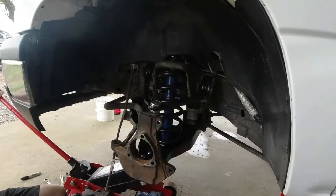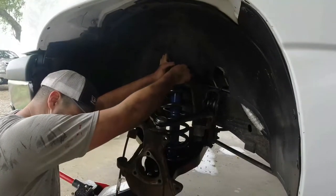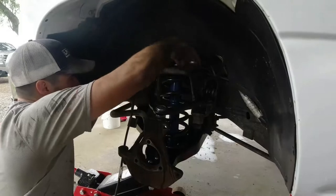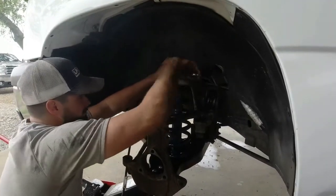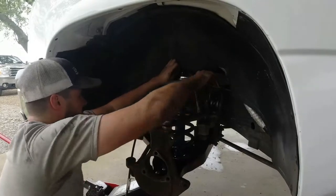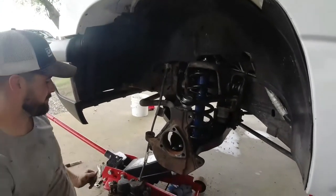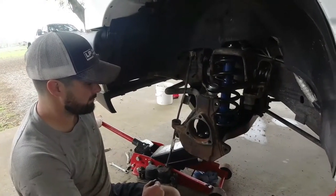Jack up on the jack a little bit, kind of get our shock more in place so we can fit our top nut. Once our shock's tight, we'll go ahead and take our jack out. Another great invention, the gear wrench. Got turned on to those about 20 years ago. Spindle back on, tighten our ball joints, and then on to the hub.